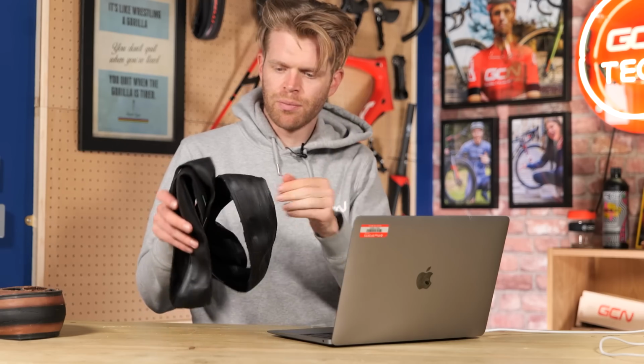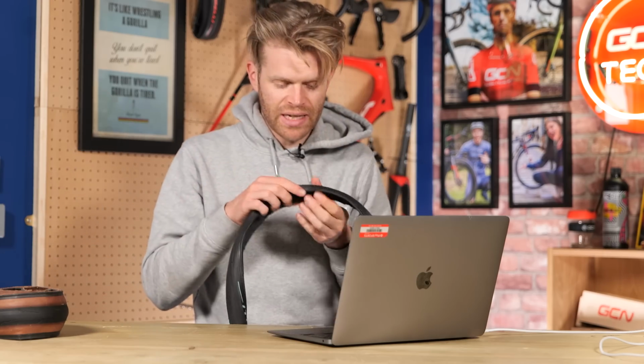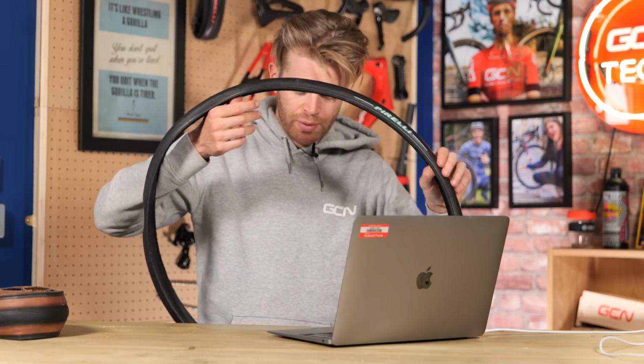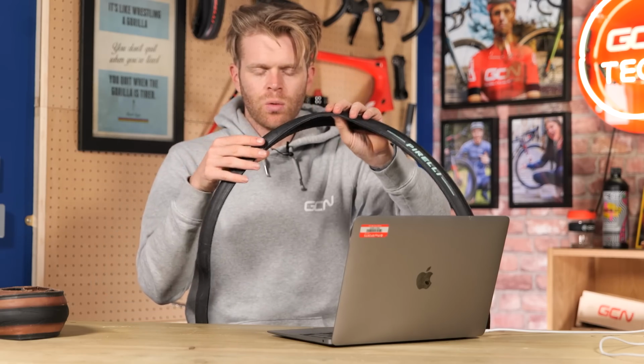So the wheels, it sounds like you've got our clincher wheels. They have a rim on the side with a hooked wall, which the bead sits in. Now, folding clinchers and clinchers that don't fold all have a bead. It's the part of the tyre that connects into the side of the rim and holds it in place. Folding clinchers were a technological advancement on the original ones, which you can still buy, although they're generally a bit cheaper, but they're often now found not on premium tyres, only on lower spec tyres, and they are increasingly less common. They will look like this, like a whole round tyre, and that's because the bead isn't designed to fold.